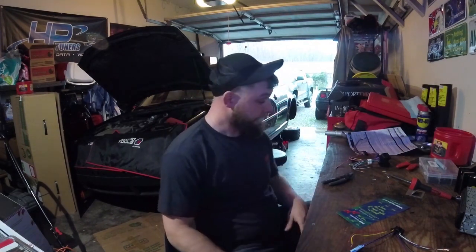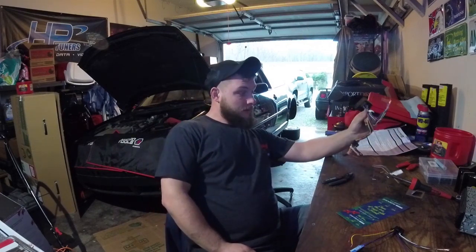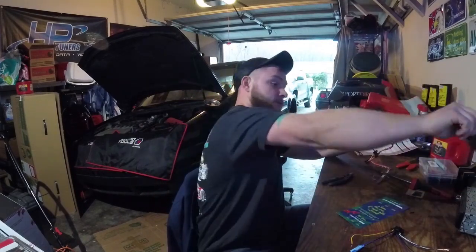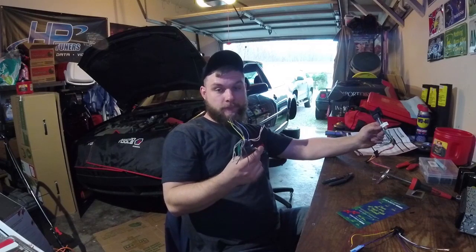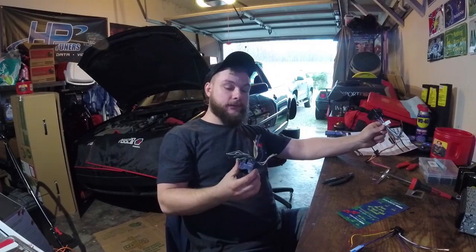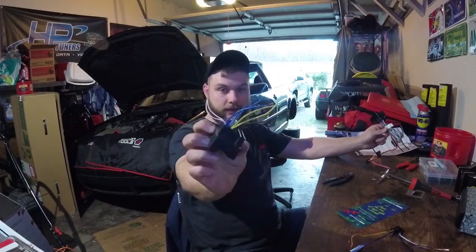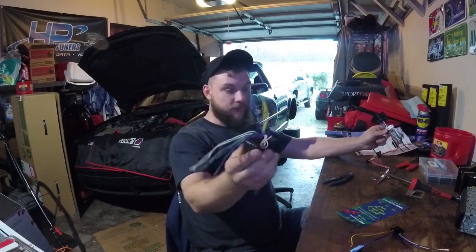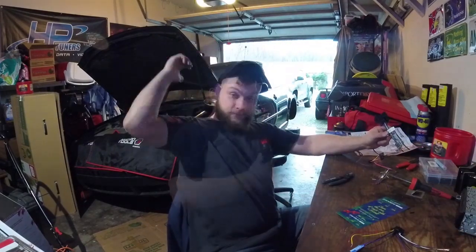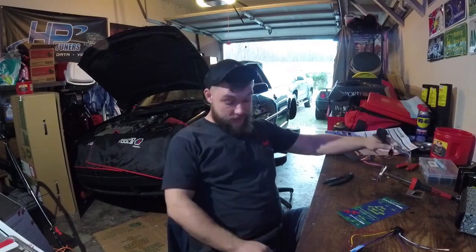Guys, so last night we figured out that this VW radio is wired like absolute crap. So we looked around on the old interwebs a little bit and found the interface I actually needed compared to this little guy right here, because the factory radio accessory power will not be retained if you use one of these little $10 connectors. So you have to hook it straight to power. Well, the remote wire was hooked into the power wire. It ended up looking like a crispy marshmallow.